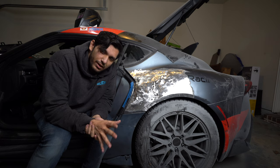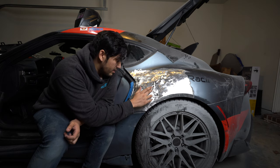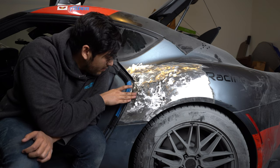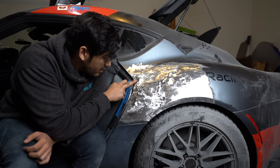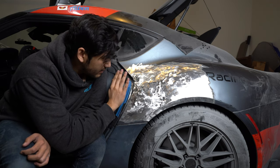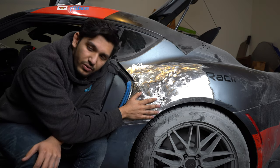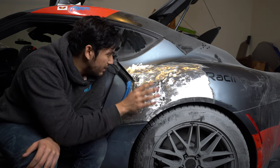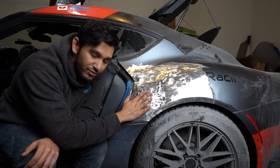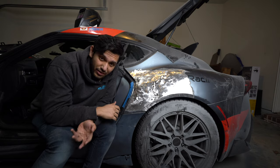I think that's about it for the metal work today. We've gotten it pretty close — this area is still a little bumpy and just needs to be grinded down more. There are still a lot of high spots from where the studs were. And over here where we filled in the gap with welds, that stuff needs to be grinded down a little smoother. I need some more grinding discs, so I'll go get those tomorrow. Overall, I'd say it's almost there — it's 90% there. So in the next episode, we'll start doing all the filler work, getting it prepped for paint, priming it, etc. Then hopefully after that, getting it painted. Thanks for watching — if you like the hack job work that I've been doing, do like the video and subscribe if you haven't already. I'll see you guys next time.